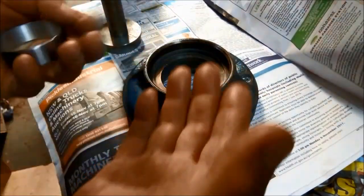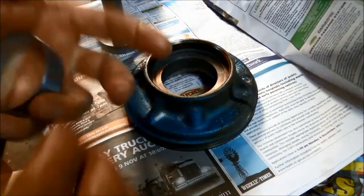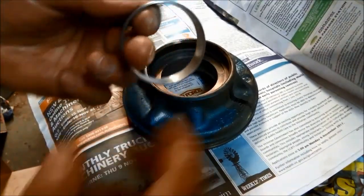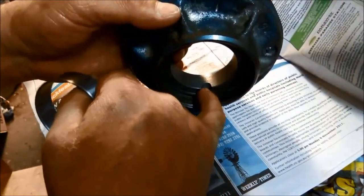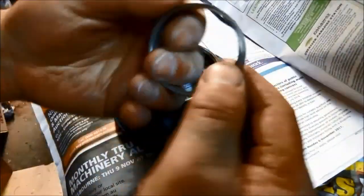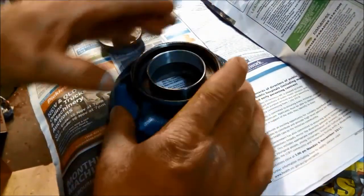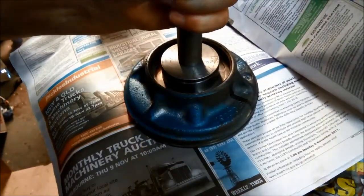Putting the bush in - remember to have it level with the converter side of the pump, so we want that bush sitting as close as we can to the torque converter. Also, there's a little drain groove on the bush - just make sure the join of the bush is not aligned with that drain groove, put it in a different position. Go ahead and press that in, making sure it's nice and flat.